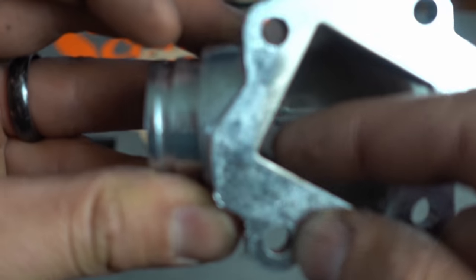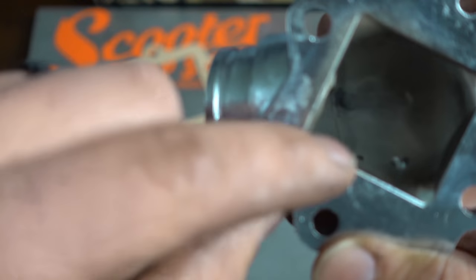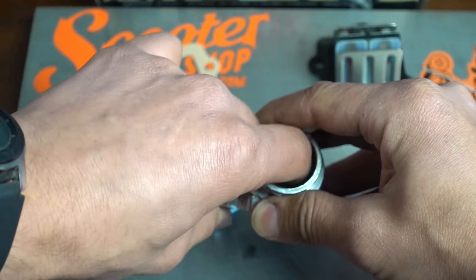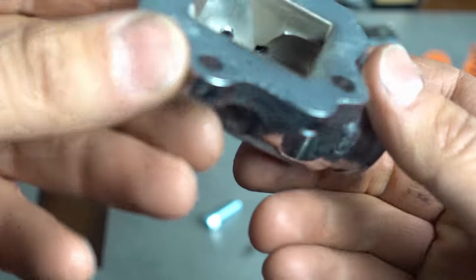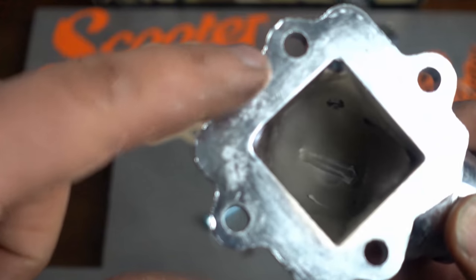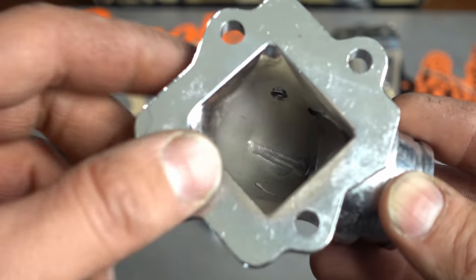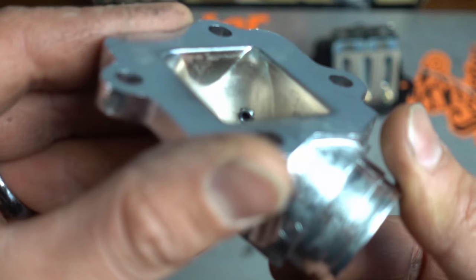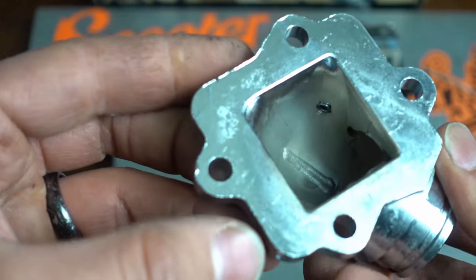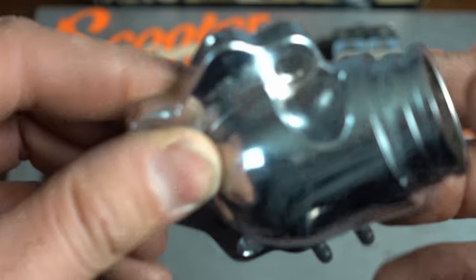It's all over here. You've got a big sharp edge right here, another sharp edge right here. This hole in this area just has chunks of plating falling off as you touch it. It's chipping off. That's what you get — it's pretty poorly cast. You've got some real sharp edges, and this is to be expected: it's $29 shipped to your door. A lot of times these edges are not going to be true and it's not going to sit flush on your engine. If it doesn't sit flush, you're never going to get a good air seal. I can guarantee this one's not going to sit flat.